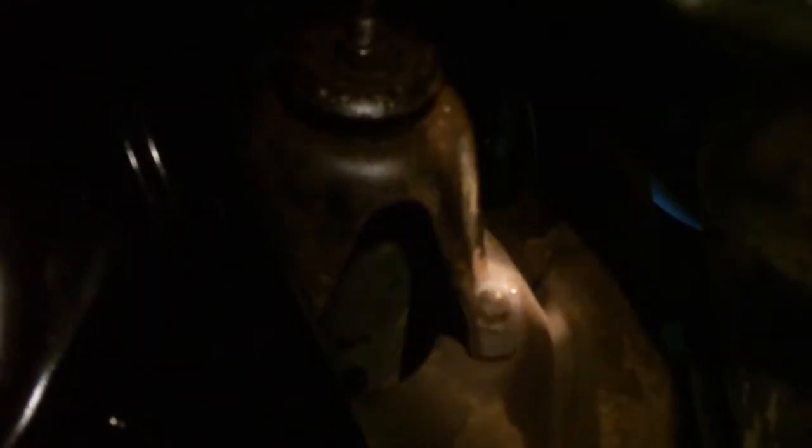So we're under the hood right now, and here's the top of the shock tower. Basically we just have that nut right there that's going to come off, and this whole top piece should come out. And then this whole crown-type assembly — there's a couple bolts. We can get at one of them right here; the other two we'll probably have to access through the wheel well.